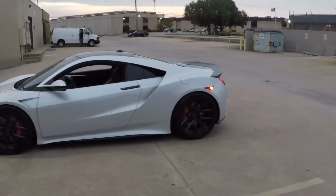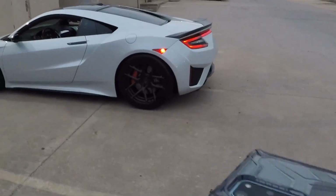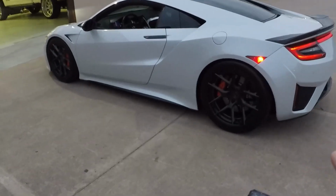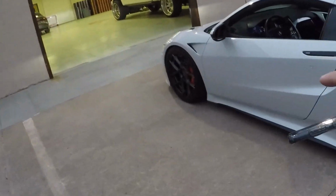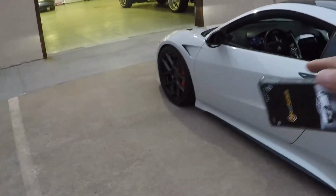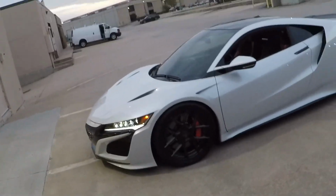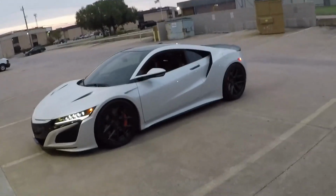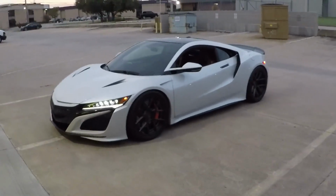So this is gonna run for 15 minutes. I noticed earlier when I was testing it that the gas engine kicks on as soon as you remote start it. It'll die out after a few seconds, and it's in hybrid mode. So the ready light is on the cluster, the AC is still on. So, you know, technically it's still remote started and everything is energized and working as it should, except for the gas engine is off.